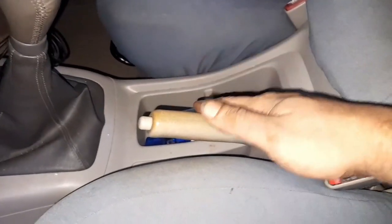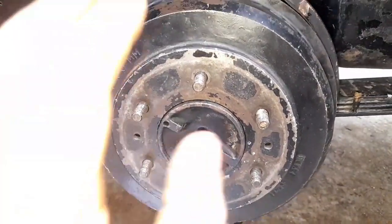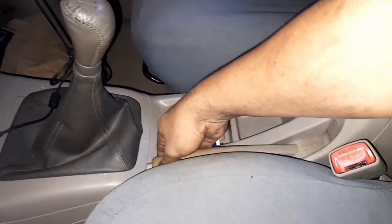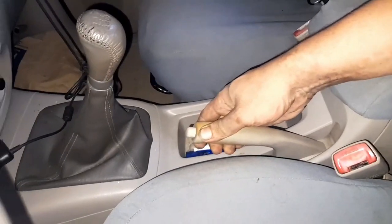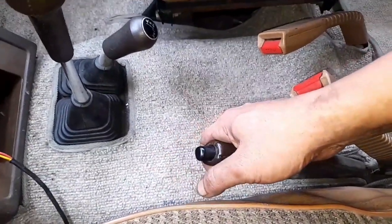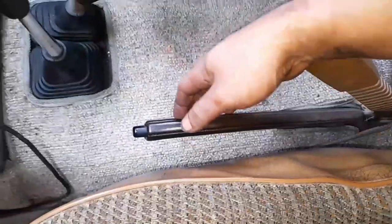The procedure is more or less applicable in all vehicles. I'm demonstrating on a Toyota Innova and a Pajero MK1 first gen. First, count the number of clicks your handbrake ratchet produces. For the Toyota Innova: one through twelve — twelve clicks. For the Pajero MK1: one through eleven — eleven clicks. Take note of those numbers.